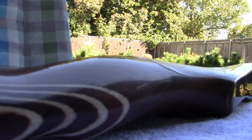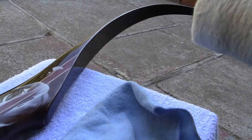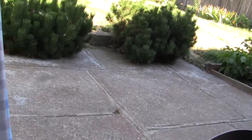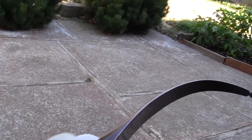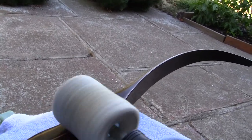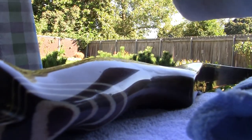It will depend on that — how much you do it. Then you want to have a nice clean cloth that doesn't have any other type of polish on it. So what I want to do is go just nice and easily back and forth. You want to stay off the edges — remember to stay off the edges, you'll burn right through.